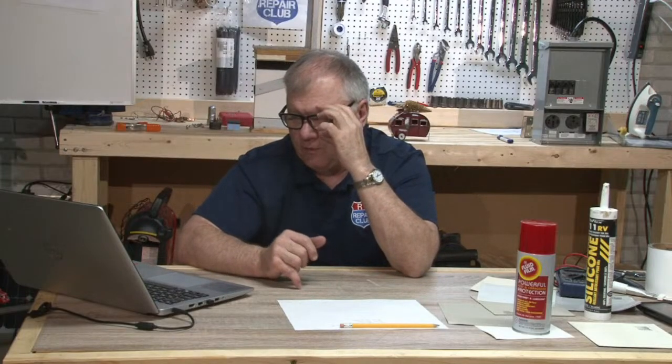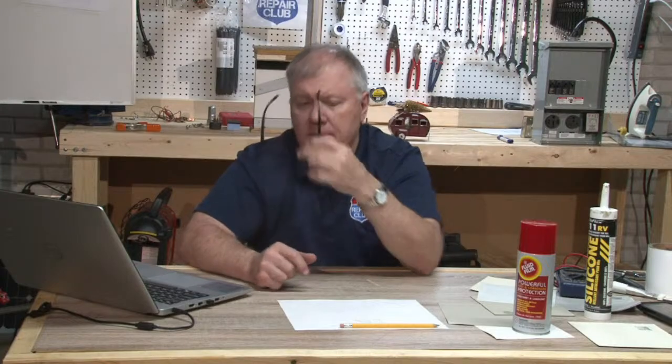You might have 250s coming off that, but they go into an automatic transfer switch, and then they go into the distribution center. So there's no place on the actual generator that you can tie into those, because they're going to the distribution center. You would have to go up to there or gang from the back side of it.